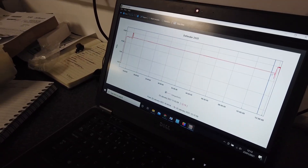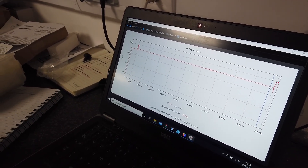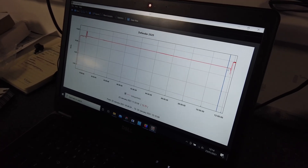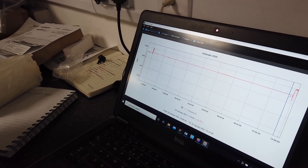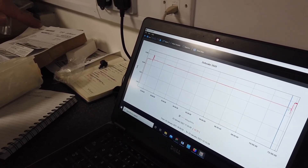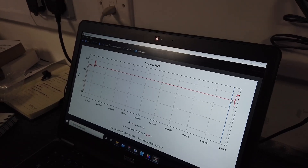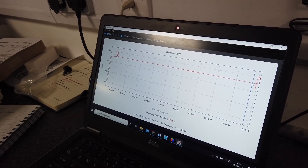Let's summarise this video. What have we learnt? We have learnt the RS Components £28 data logger is flipping brilliant — it will record the data, it comes with the software, so you can get an insight into what's happening on certain voltages, and it seems pretty accurate. We have also learnt that the sat nav take-off loom that we've done — that we're going to put in the overhead loom on the Defender 2020, and I suspect on the same Range Rover and Jaguar models (we've got someone trialling it on a Jaguar I-Pace) — it looks like that voltage stays live, so it doesn't go to sleep after a period of time. So you can use it to power a full parking-mode dash cam. I hope you've liked that video and we'll get those dash cam looms up for sale.